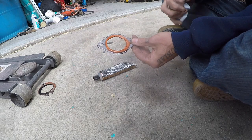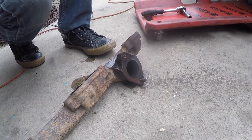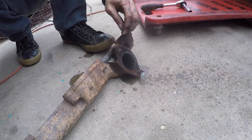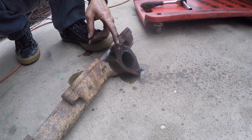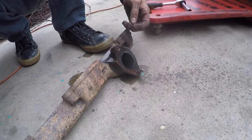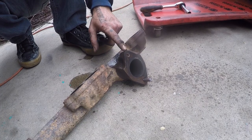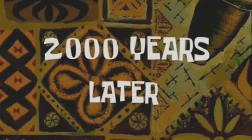We install the gasket the same way we removed it, tighten down the bolts, and move to the other side. This is why you want to use penetrating oil — PB Blaster or whatever — because a lot of times these get put back cross-threaded or rust up badly, and trying to take them off or put them back on can snap the bolts off. I don't know where I'm going to find a replacement for this '56 header, so it's got to be drilled out. You may have to take it to a machine shop to have them drill it and tap it.